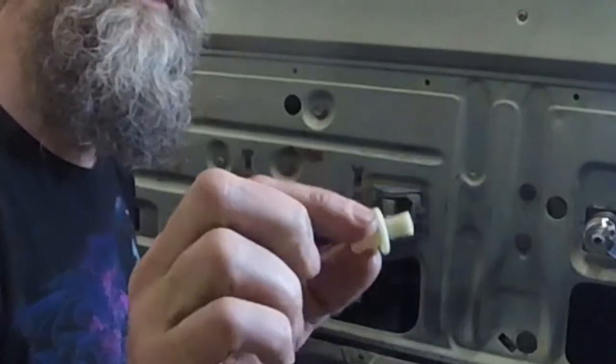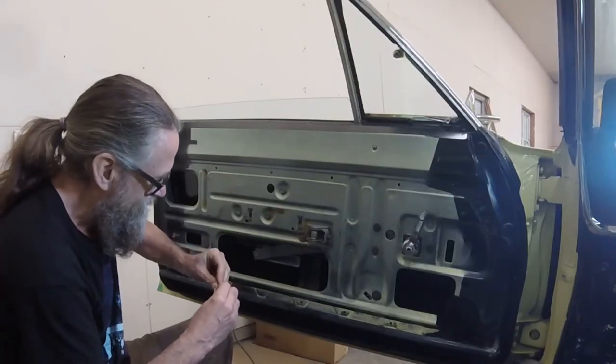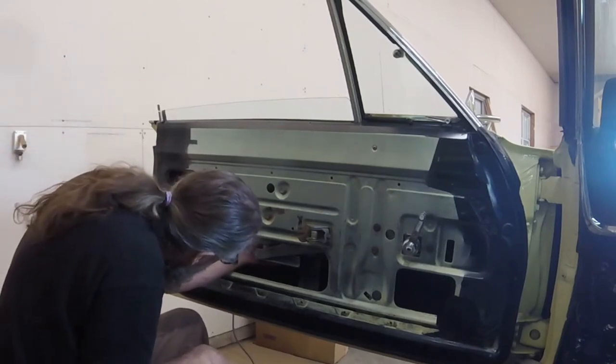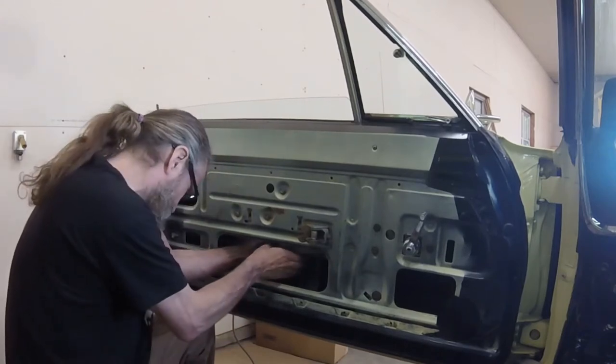Now the nylon rivet can be inserted into the hole. The plug has four barbed prongs that grip the edge of the hole in the glass. Their diameter is slightly larger than the hole's diameter, so they have to be compressed inward to pass through the hole.